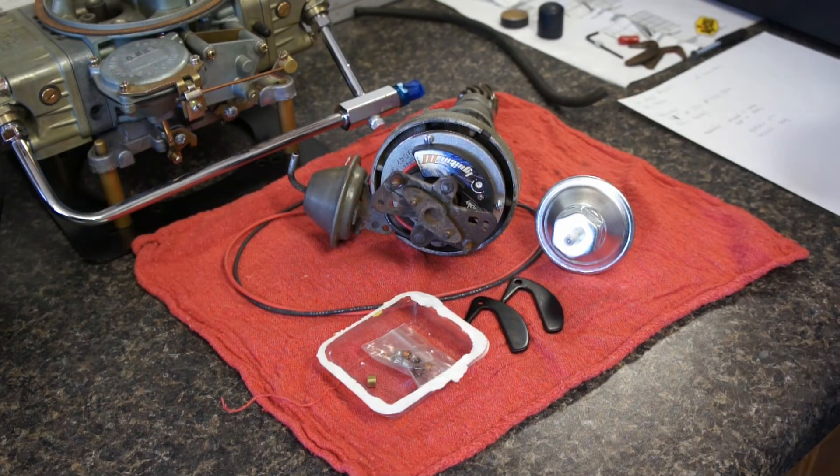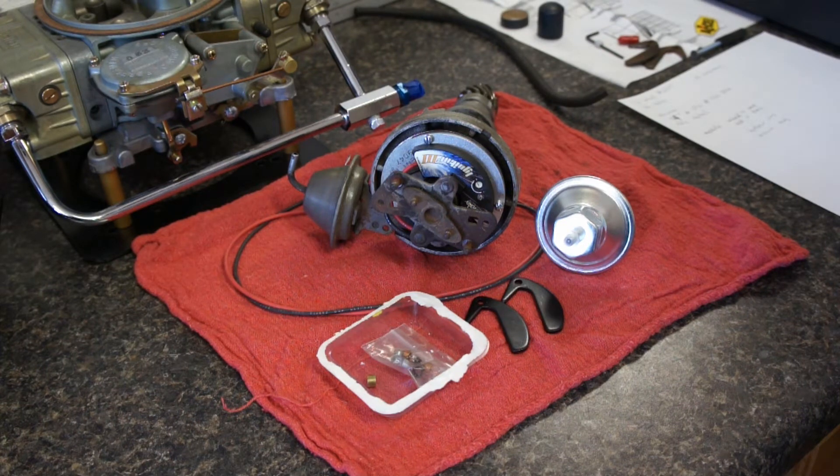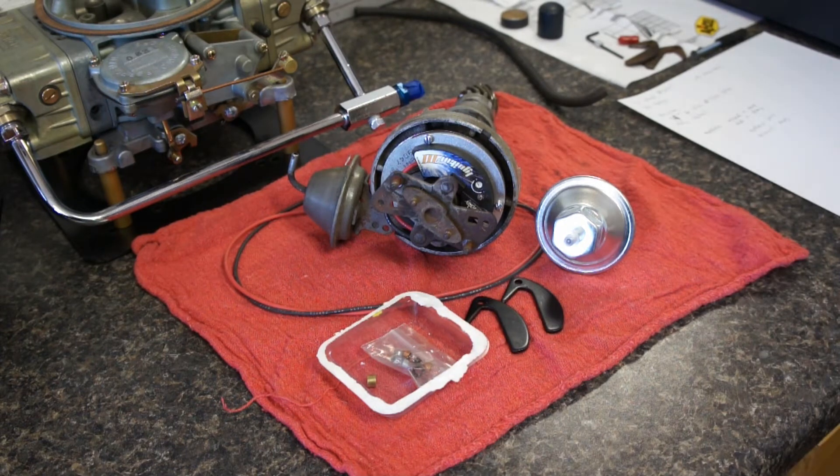I think I'm going to set it to around 49 or 50 degrees total advance. I'm going to try to set the distributor up for about 22 to 24 degrees. I want to run about 12 degrees initial with 34 to 36 degrees total advance. I'm hoping the 9.5-to-1 motor with iron heads can handle that much centrifugal advance with 91 octane fuel.